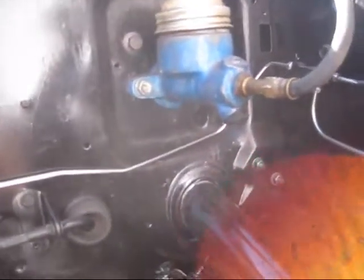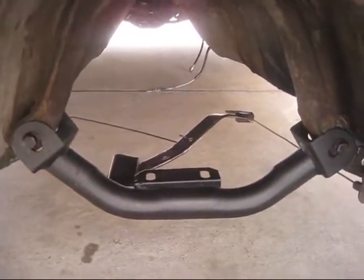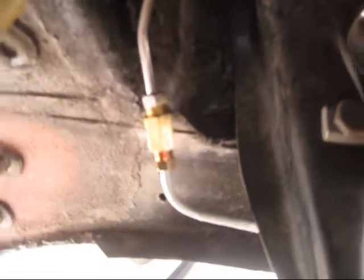The calipers do work — everything's working pretty good. I also got the front part of the emergency brake setup done and got my T5 conversion crossmember installed, so that's all coming together. You can see the lines running into the shock towers. They connect to an 8-inch line which converts from 3/8-24 thread to 7/16-24 thread, and that hooks into the hoses going to the Granada calipers. So front brakes work — pretty happy about that.